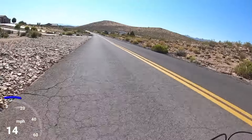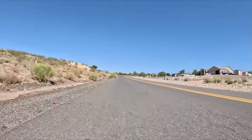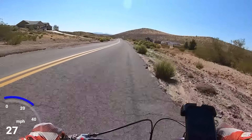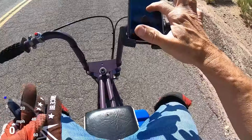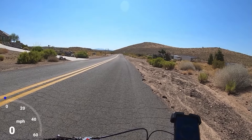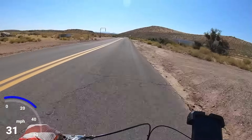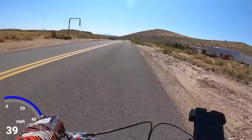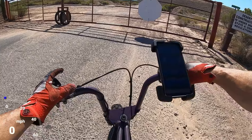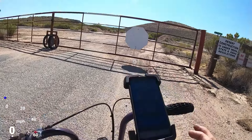Let me go see if I can beat 4.93. It already feels like it runs a lot better. Duromax 208, VM22 with a 120 main jet. Oh, it's a lot better — it runs so much better. We did 4.20, so we knocked off more than half a second — definitely a lot quicker from 0-30. Let's see what we do for top speed.